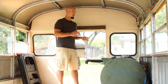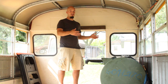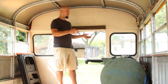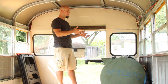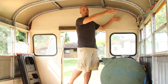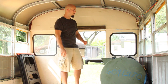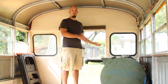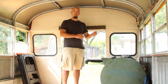This isn't our final system in the bus — this is just the early stages of construction that allows us to use the vegetable oil system. Right now we're filtering the oil in the shed, which you'll see later. But when the bus is finished we'll be able to filter the vegetable oil right on board. We'll have an additional tank up here for dirty oil, this is the clean oil tank, and then we'll have the centrifuge right here. That'll allow us to drive up to a restaurant, pump the fuel right into the tank, filter it on board, and head on down the road.